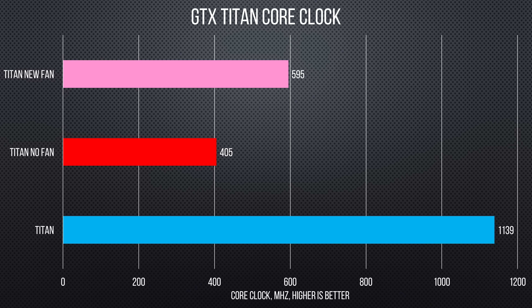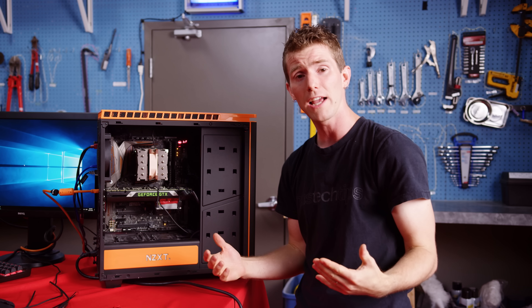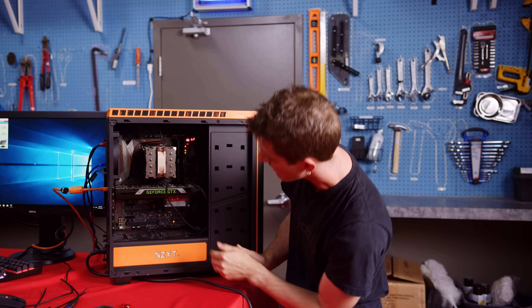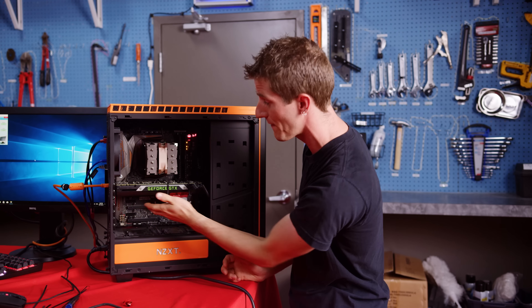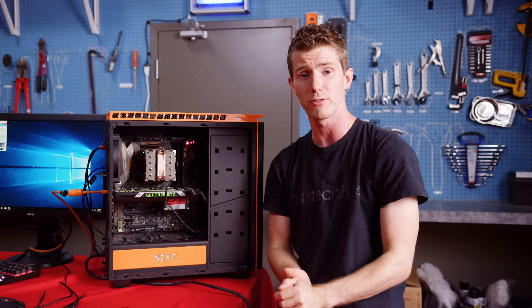To be clear, that's better than no airflow at all, but if you're running a very high power GPU, you're either going to have to get a little more creative about your cooling — perhaps removing the shroud altogether and attaching the fan directly to the fins — or using a much, much more powerful fan.